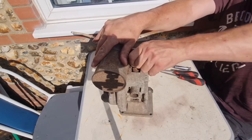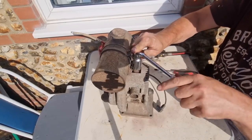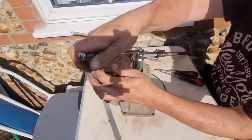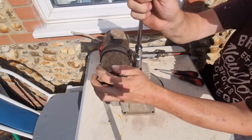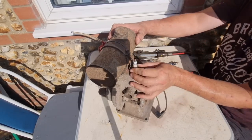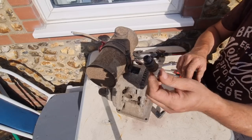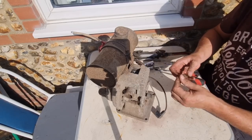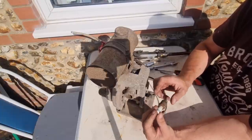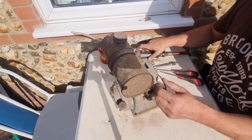This hasn't been off for a long time - there we go, it's got a Bosch plug in it. So let's pop this plug out. Steel in aluminium don't always go the best - nope, that socket is stuck on that silly screw I put in there for the tank. There's our plug - actually it's rusty as hell. Is it the right number plug? There's no number on it, that's just Bosch Germany. There might be one if I clean this up on the wire wheel, but you know the motto of the channel - we'll try and go with what we've got.